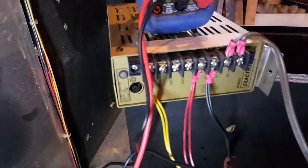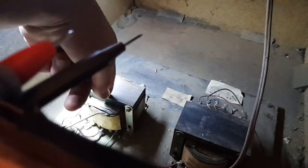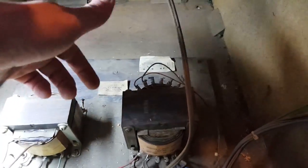Things I want to test: I want to test this switching power supply. I think this is the monitor power supply and this is the isolation transformer for the monitor — and this transformer was for the Pac-Man PCB plus the lights. What's interesting about these Pac-Man cabs is that the Pac-Man PCB actually gets AC — 5 and 12 volt AC — and the power is converted on the board itself. But you can still send DC because it ends up being 5V DC anyway.